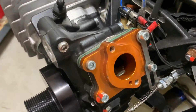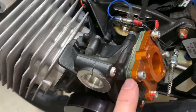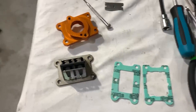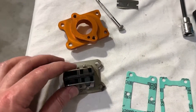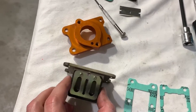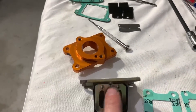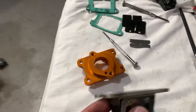This is the reed valves down inside there, so I'm going to take this off and replace these gaskets because I did order those, along with new reed valve petals. The reed valve has been removed, petals have been replaced, and they did go on in a very specific way. You can tell — this side has a slit, this corner is cut, this one's rounded, this side has a hole in it, this one does not, but they both have this corner.